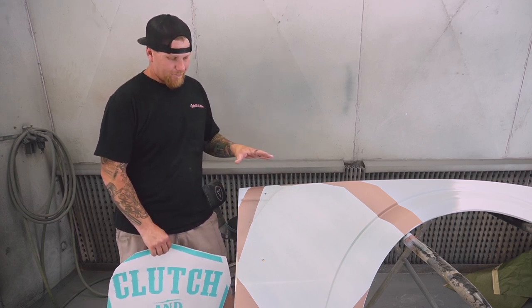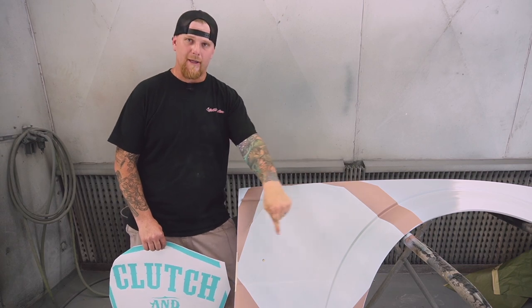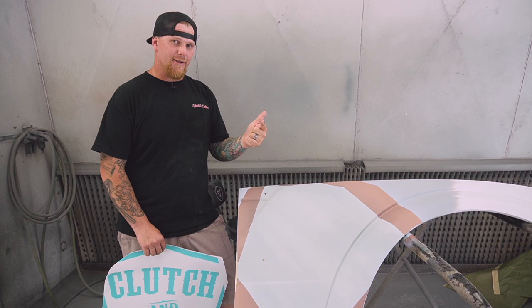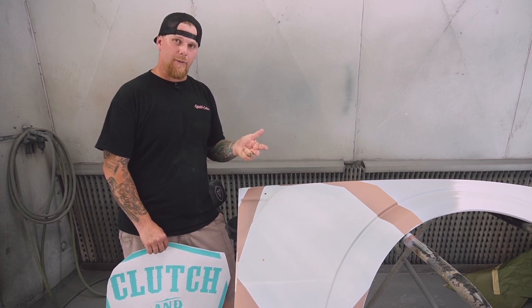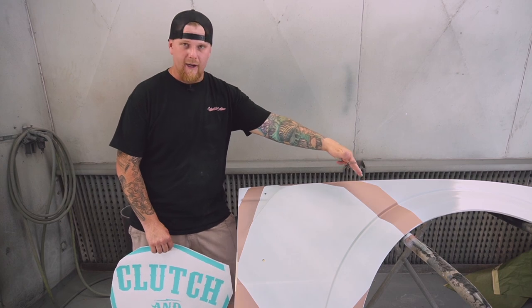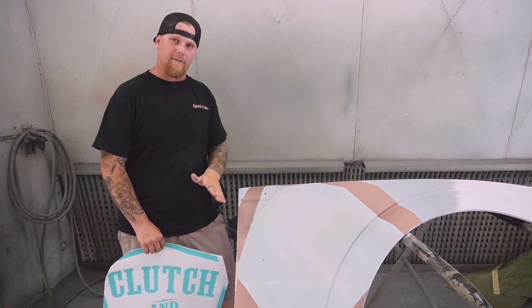At this point, we have come through from beginning to end with backplane material being the area that you're going to light, step one. Step two, we did dielectric. That's your insulated coating. Step three was the color that you're going to be lighting. In this case, white was the Luma color. And then we laid out our bus bar, which is what you're seeing here in the copper color. We then connected our wires. And the fifth time, we went back through with the conductive top coat.